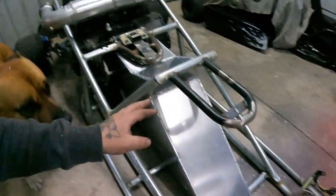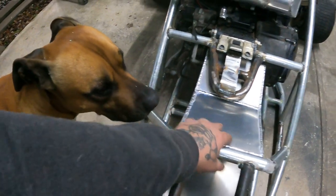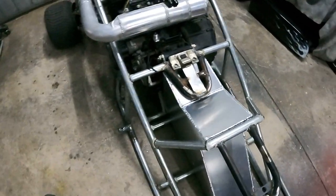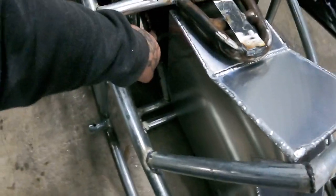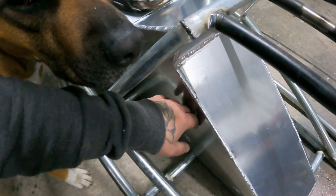It actually looks better like this. I've just had to notch out the bottom of the tank and we'll weld a bit of flat plate there. The tank's almost done — really happy with how it's turned out. Chain clearance looks good — the chain will run pretty much alongside it the whole way with about a finger gap behind there, which is plenty. If I get nervous I can always put a bit of plastic on the side.